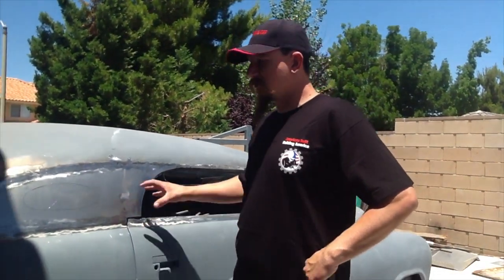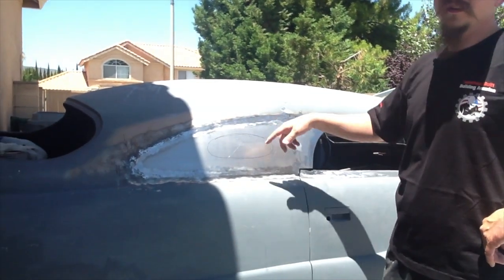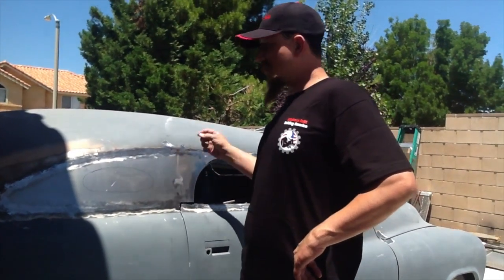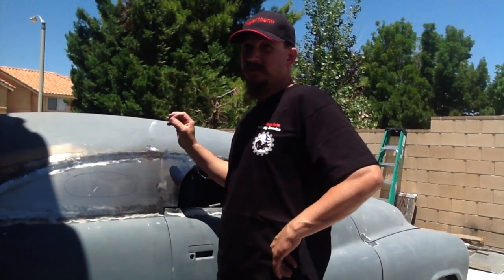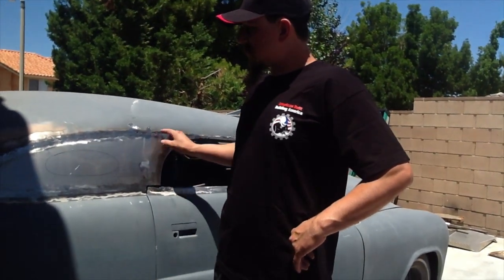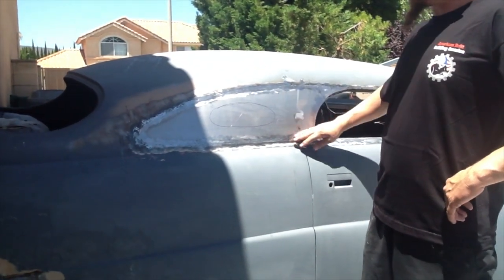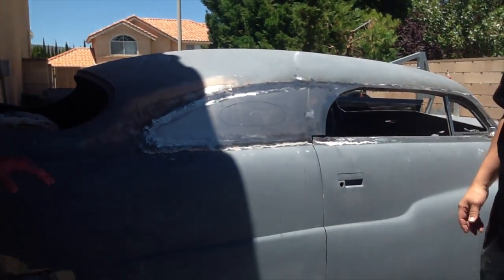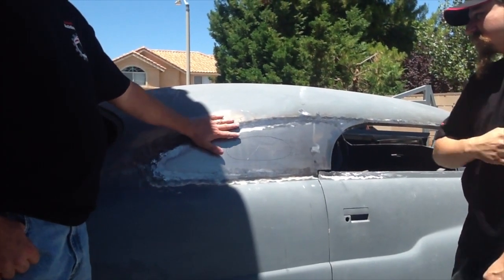I used the Powermax 45 to cut out this piece of sheet metal here. There was actually another piece of sheet metal welded on here for mock-up purposes that someone else did. I used the Powermax 45 to take out all the little spot welds — it has a real nice bit on there that'll take out spot welds. Then I just cut out a new piece of sheet metal right here; didn't take me long. Put it in the English wheel, got my nice shape, welded it all nice and flush, and did the same thing to the inside too. I was able to radius this really nicely so it's going to follow the body line, and we'll do some finished body work and it'll look like it's supposed to be that way.